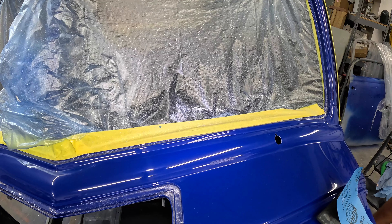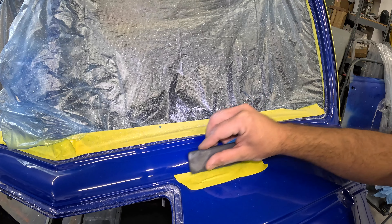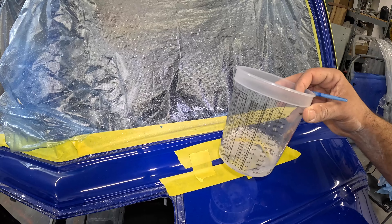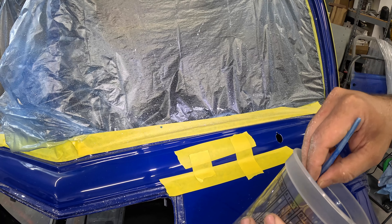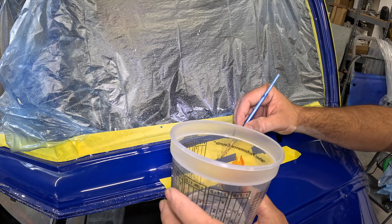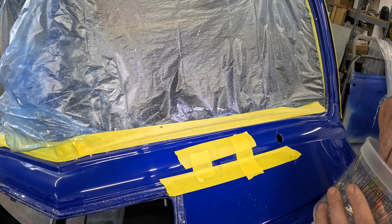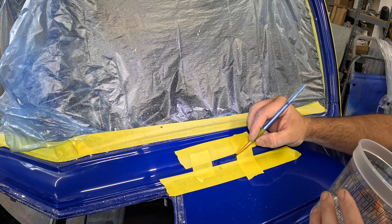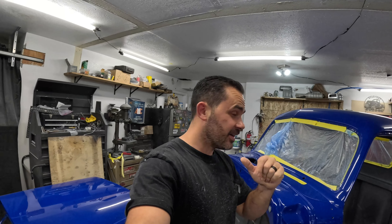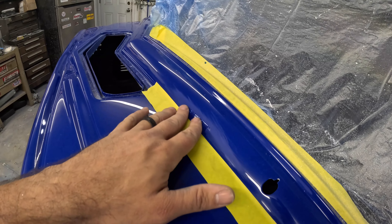Now I'm essentially going to waste a lot of tape to mask off the area. It's been about 45 minutes since I actually put the last coat on — it's had plenty of time to dry. This base coat dries really fast. Same thing — way too much clear, but I want it to be mixed properly so it's got the right mixture. The idea is the clear is a lot thicker, so I'm going to try to build it up. Try to wipe away that drip too. If I can build it up in that area with a couple coats, sand it back out, buff it, and hopefully it comes out okay. It's the next day — I really wanted to let that clear set up and dry. It's nice and hard now and it looks pretty good. I'm excited to see if it actually works.